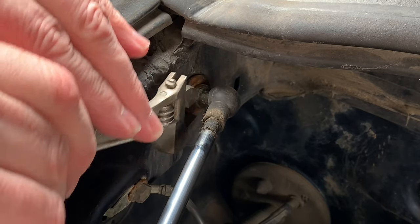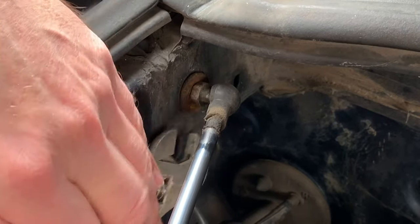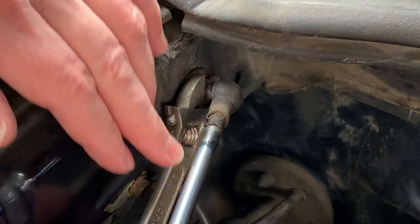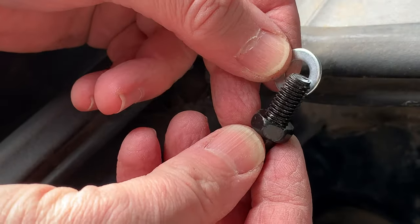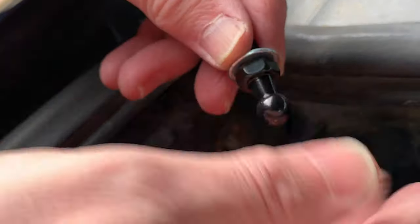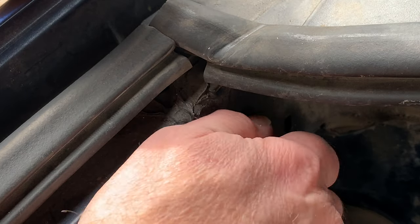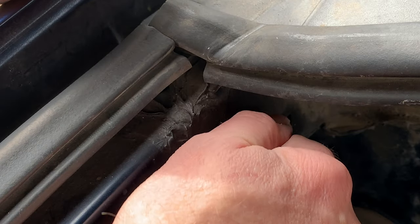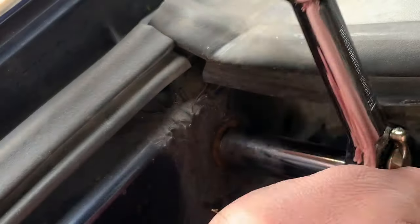They're a little crusty but they're not resisting too much. Okay, now we've got the other bolt out. The new package came with — if I can get that in the picture — a new bolt and new washer, and we're going to pop those in there because the new strut will just pop onto this. Just go slow because you definitely don't want to mess up your threads here. It's a little rusty, but I've got a socket and we'll just snug it.